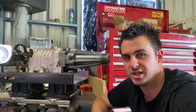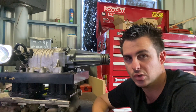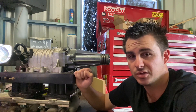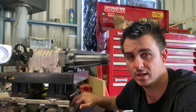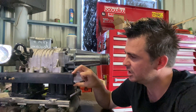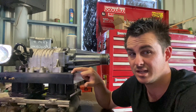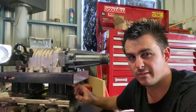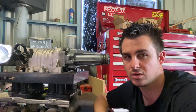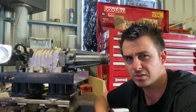Here's my current M90 supercharger setup on the 1UZ. That's the Eaton M90 off the L67 Holden Commodore. I've made my own adapter manifold that basically replaces the top intake manifold on the 1UZ — bolts to the stock lower half. It's made out of 10mm aluminium plate on the top box section, the flange plate the supercharger mounts to is 6mm steel, riser tubes are 45mm, and 10mm plates on the bottom bolt to the stock lower intake manifold.